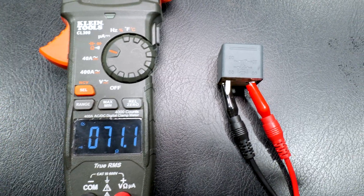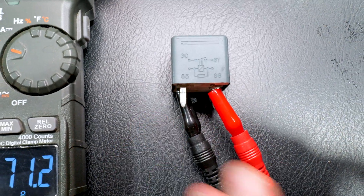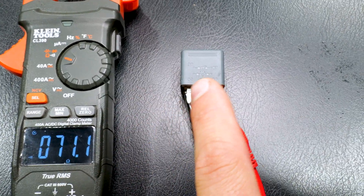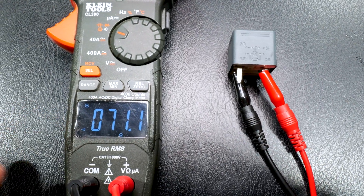Let's check it with the multimeter. So I normally start with a multimeter, test them quick and easy. First up, we got 85 and 86 — that is the coil. We have the contacts on there. You can see we're reading 71 ohms. This coil in here is good. It's a little coil.